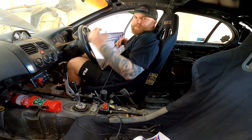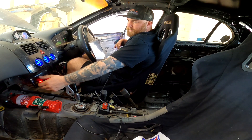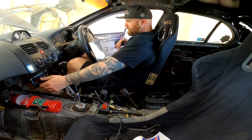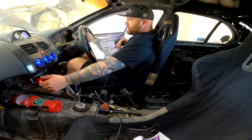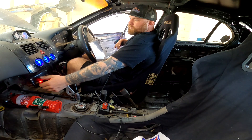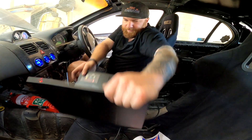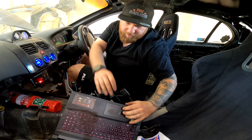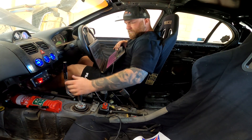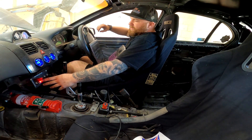Alright, so we're in here. Everything's going to be dry, so let's just turn the ignition on and prime it a few times. I'm just going to turn the fuel pump on here and make sure there's no leaks. It is going to need a lot more fuel to try and start — if I crank it, it probably won't even splutter. Who knows? I don't generally need a lot more, but we'll see.